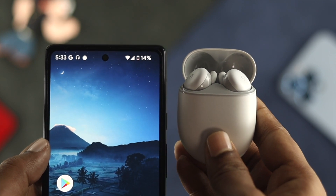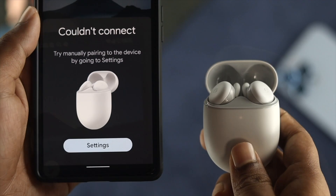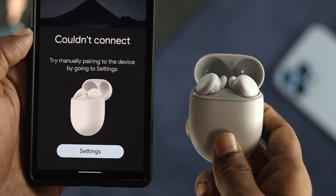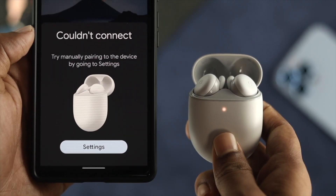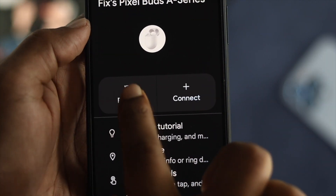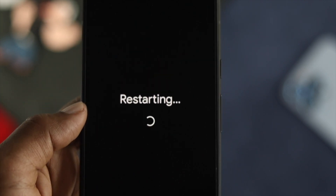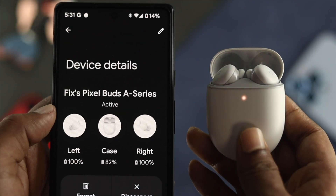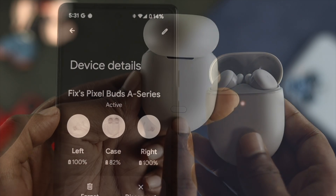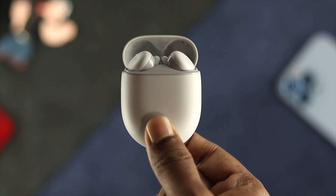After ensuring all this important work, let's do some troubleshooting to solve the Google Pixel Buds not connecting issue. For the advanced troubleshooting process, the first thing you want to do is delete or forget your Pixel Buds and restart your device. Next, make sure to charge your Google Pixel Buds and press and hold the back button until you see the light start blinking with an orange color.